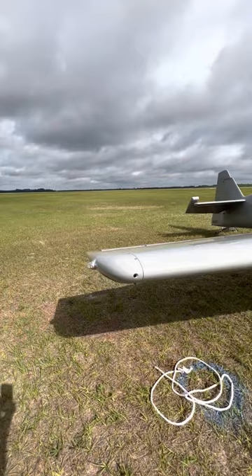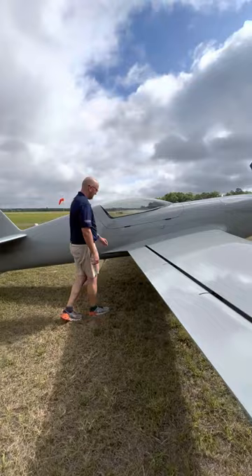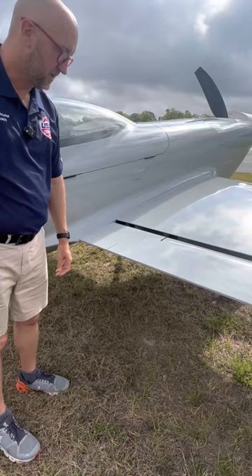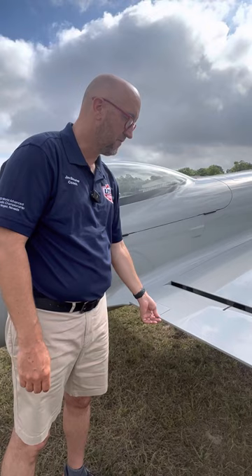Here's our aileron trim right here. This aircraft has trimmed with maybe one degree of aileron trim, but if you did have an out-of-trim situation, you'd be glad to have it. Because the ailerons go so far inboard, as you trim the aircraft to different airspeeds you'll have a little more effect from the ailerons, and it's nice to have aileron trim for cross-countries. With the autopilot it doesn't really matter that much, but it's a nice thing to have.